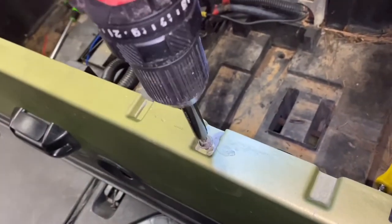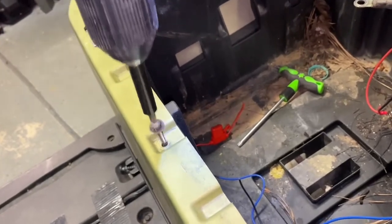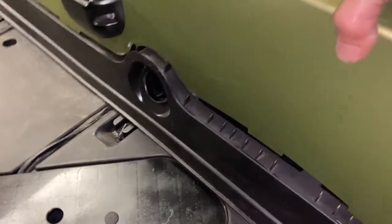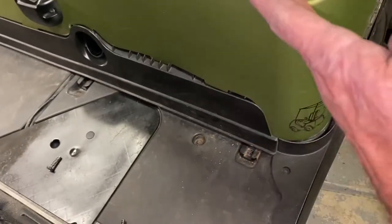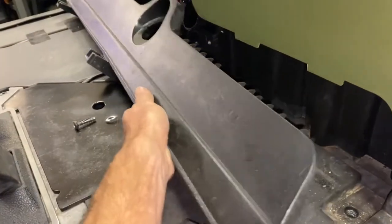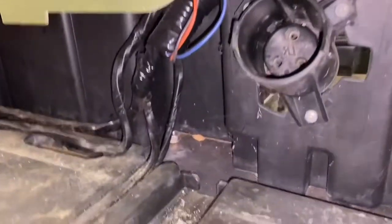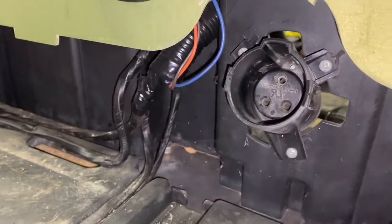What I usually do — there's going to be two screws. You generally don't have to pull them all the way out, but I'm going to pull them all the way out. You can lift this body up just enough to where you can slide this little kick panel out of the way. Some things are better with two hands. Now we're going to have three Phillips head screws — you can see one there, one there, one on the other side. Let me take those out.